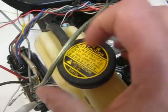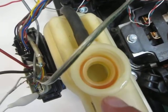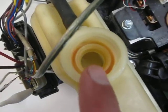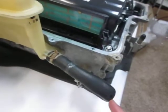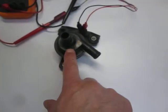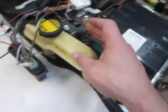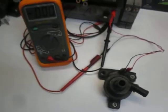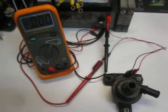You can also look in here — open the cap like this. There's water in here, but the inverter isn't spinning because nothing is connected to it right now. If you don't see any coolant flowing — because it comes out of the inverter, through the tank, out to the pump, and back into the inverter — then you know this pump is no good. Get your inverter coolant pump changed. This is like a two-thousand-dollar part at the dealer; you can find them used. The computer knows when the inverter pump's not working — get it fixed. Zookeeper out.